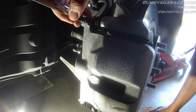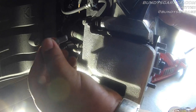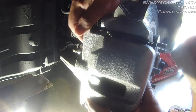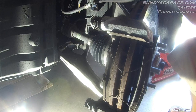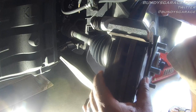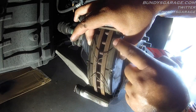Putting the wrench on the caliper bolt, knock it open with my hand — that gets it loose. That way we will get the caliper out. So I took the brake caliper off. Right here is one brake pad, here is the other brake pad — the outer one and the inner one. Right here you have these brake pad pins.